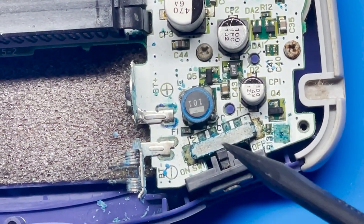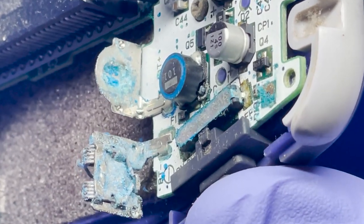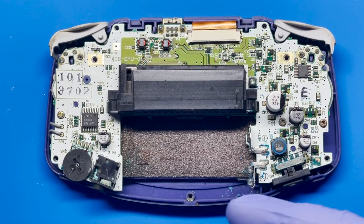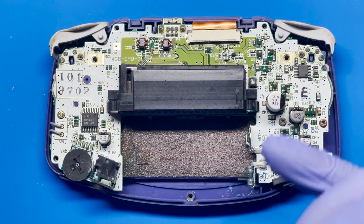If we move over to the power switch, we can see that there's also quite a bit of corrosion. Here you can actually get a pretty good look at how much residue is on the terminals. I'm gonna go ahead and remove the screws from the motherboard so I can free it up. I suspect there's a little bit of residue on the other side, seeing as how dirty these contacts are. So let's go ahead and remove those screws so we can free up the motherboard.